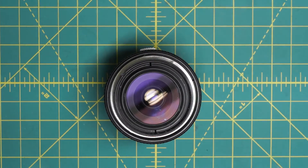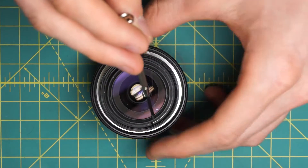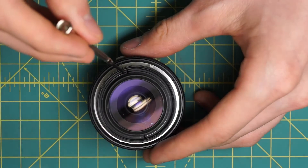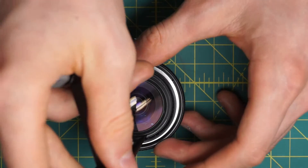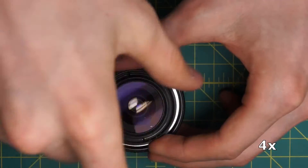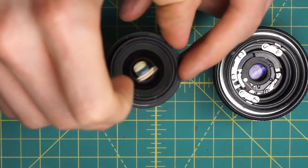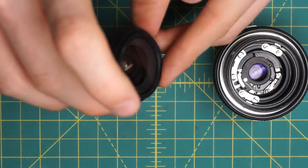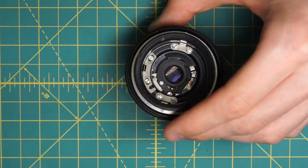So I'm going to remove the optics here first. In this piece there's the front section here and then two lower rings. The lower ring here has two divots for a spanning wrench. You can use a pointed tip spanning wrench or a regular spanning wrench to undo this because it has larger gaps for the spanning wrench to fit into. You can see the size of the front optical piece — it's a different kind of layout than on the 50mm lens with many more optics in front and then a much smaller back optical piece.